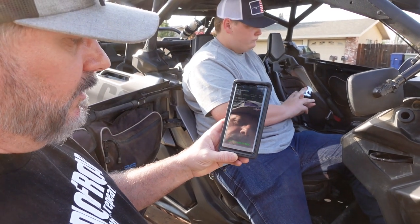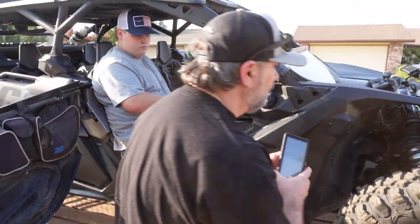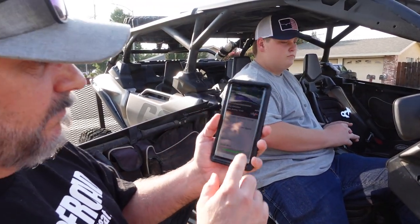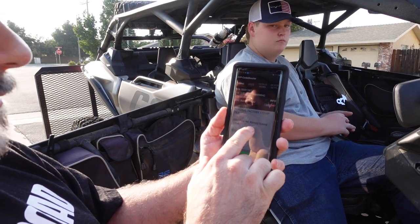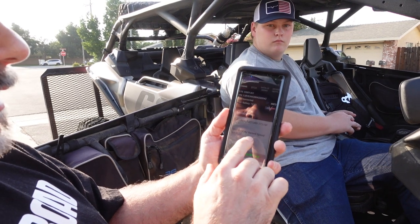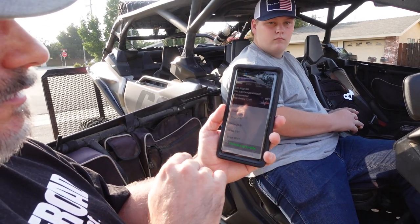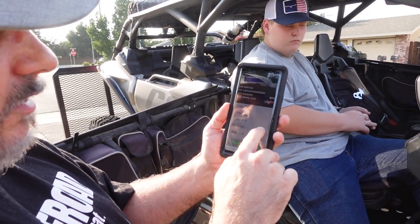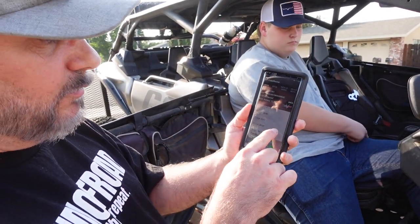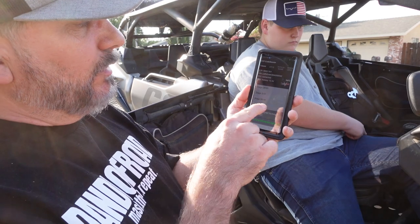and then that just pulled your VIN number. Sure it's the right one, right? Yeah. All right, here's what we got. So we got original with raised speed limit. So that's your original factory tune. Then we got a stage one, stage two, stage two R91, stage three 91, stage three R91, and stage three 93. So you could technically go to 93 octane, but you want to stay with 91 right now, right?